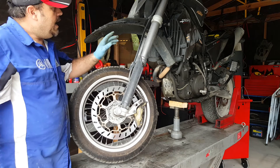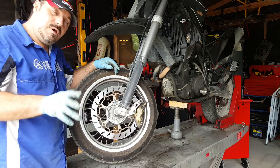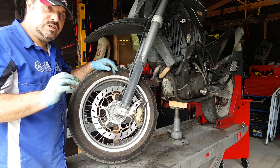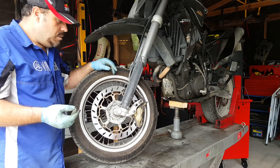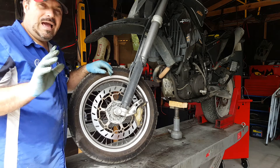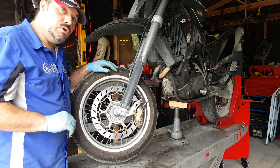Give it a few weeks. And if there had been play in the top bearing set, you may be able to adjust that. Normally it's new bearings, but sometimes you can get away with just adjusting it and the play goes away, as long as the bearing hasn't gotten notchy. Usually you're doing it by putting new bearings in there, and there'll be a video on how to fit new bearings and how to adjust them up properly, because there is a preload on most of those bearings.